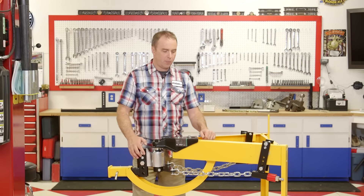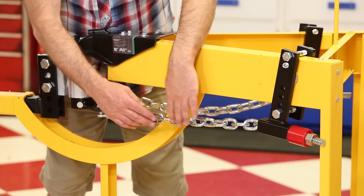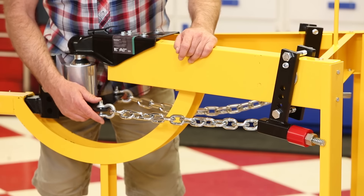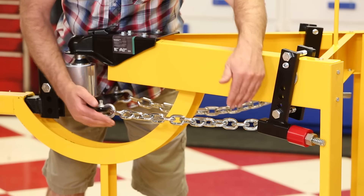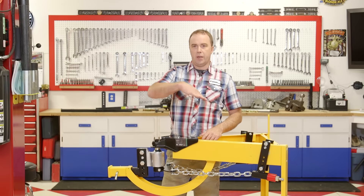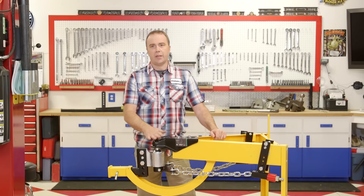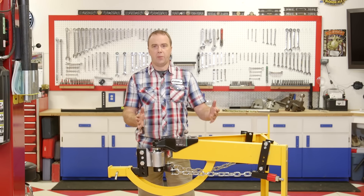It's not a standard spring bar like you'd see with most weight distribution hitches — it uses a chain system. The chain can be tensioned using a bolt and a urethane bushing. By adjusting the tension on that chain, you're actually adjusting how much weight distribution force you're getting. So with one hitch, you can go anywhere from basically zero pounds of weight distribution all the way up to 1,400 pounds — really, really flexible. It means you won't need to upgrade your system if you change trailers in the future.